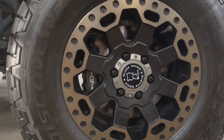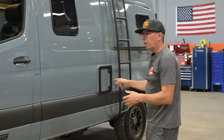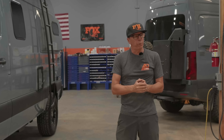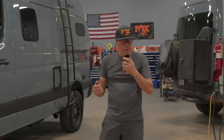The Alcon brakes have been fantastic — they really can stop this rig. There's also a skid plate and transfer case skid plate. We've got a 40-gallon tank in this. On the Winnebago you do have to run a 40-gallon tank; we also do a 47. This also has the correction for mileage-to-empty — we pull the fuel module from underneath the seat and reprogram it so your fuel mileage readout will be fairly accurate. Keep in mind, with the SME tank it's going to read full for a long period because the float is sunk, and then it'll start calibrating the mileage-to-empty.